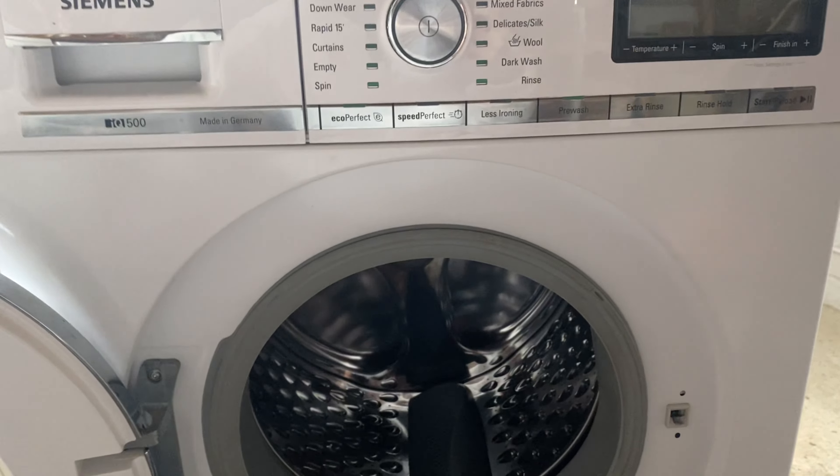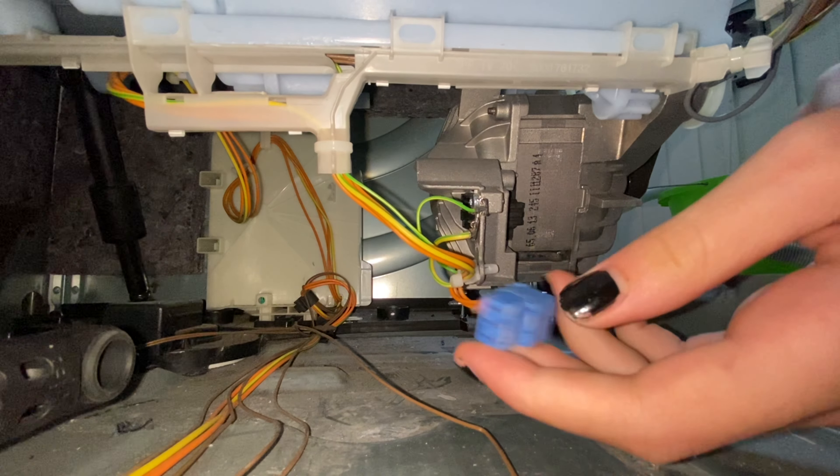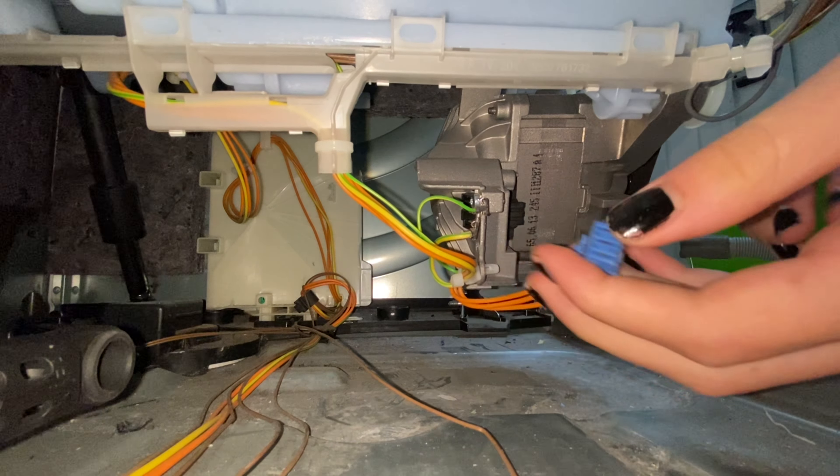Let's go inside the machine — you see here, these wires. If you look at the blue wire, this is the connector block. On some models it's a different colour, but on this model it's literally this blue thing. The connector must have three wires, otherwise this won't work. If it has any more than three wires it won't work, because if it has, say, five wires, two of them will be the tacho, and the tacho needs to stay the same — it can't be reversed.